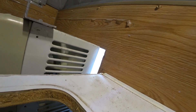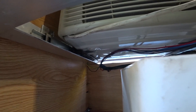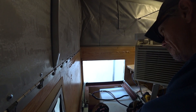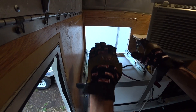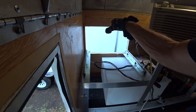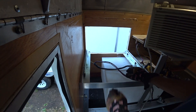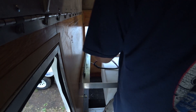That's aluminum right there so I'm not going to be able to cut through it. I could cut those feet down, but the feet need to be there. If I go below those brackets I'll be perfect — I just need to figure out how to do that. What I did was create a slant so it will ramp down and slide out that way, which I need a slight tilt to anyway to drain off the condensation. So I think this idea is going to work out pretty well.